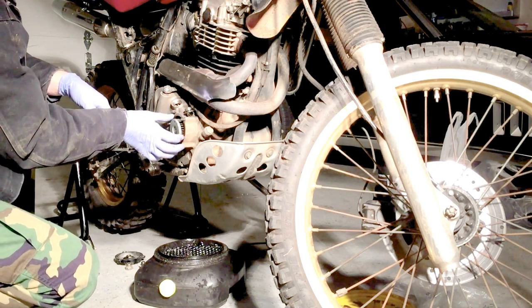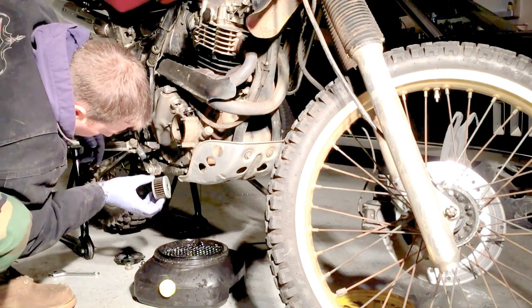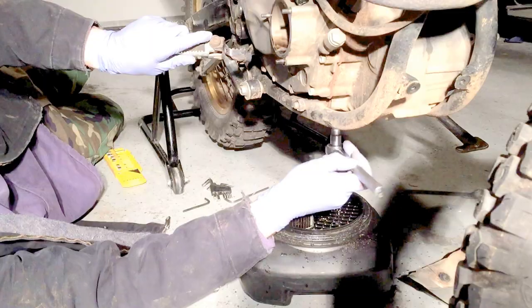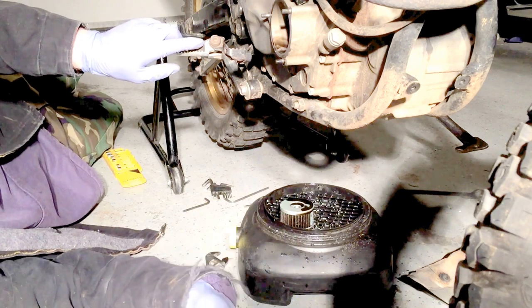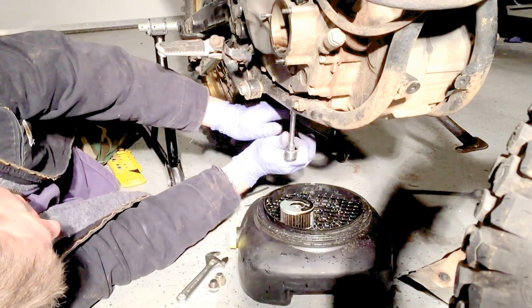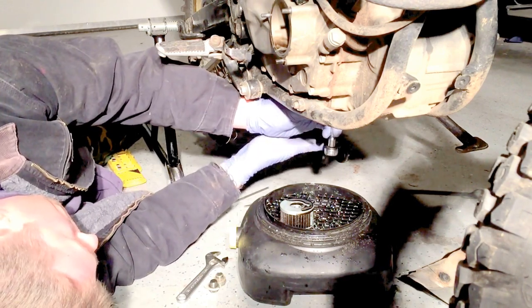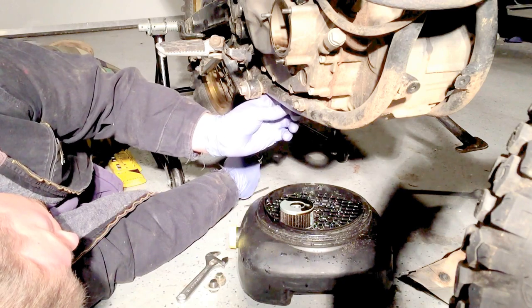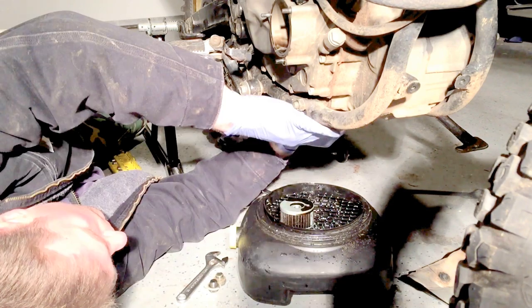Inspect. Pull that out. Look deeply into it. Look for love. And then finish removing the sump oil pump cover. The drain plug was stripped in this so it never completely sealed well. That was the reason for getting this new part.